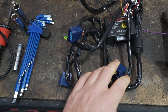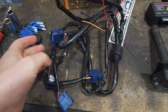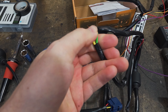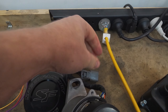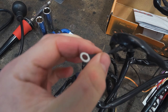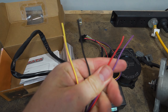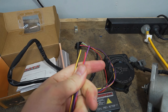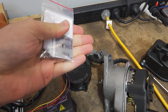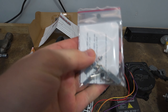The kit's not too difficult to install. You've got four plugs for the K-series coils, and two wires — one is power and one is the RPM signal — which we're going to get from this two-wire plug here. Then you have a ground for the coil packs, which is quite simple, and probably the harder part is these four wires which we need to tap into the ECU. The kit also comes with pins so if you wish you can unpin the connector and re-pin it onto the plug.